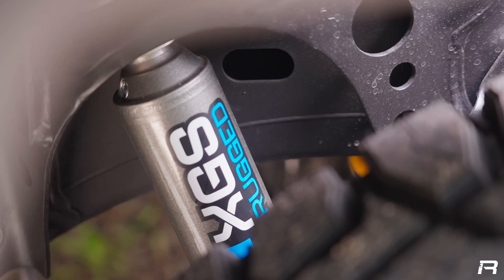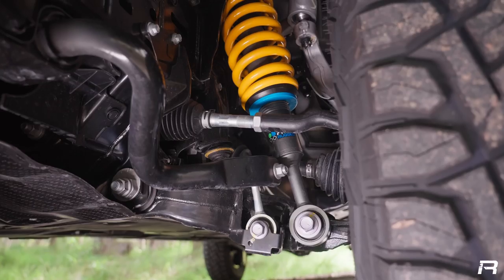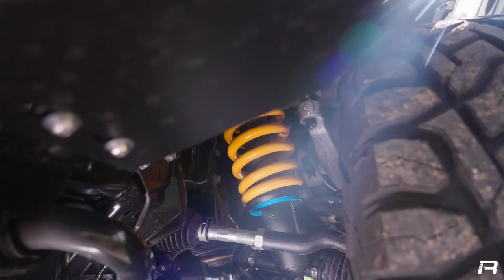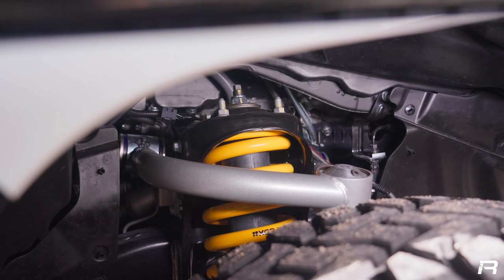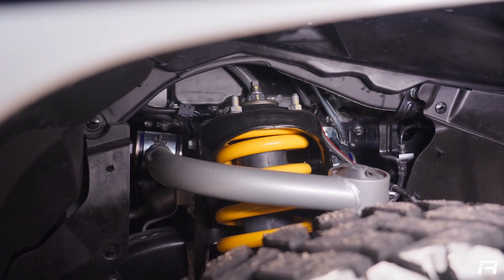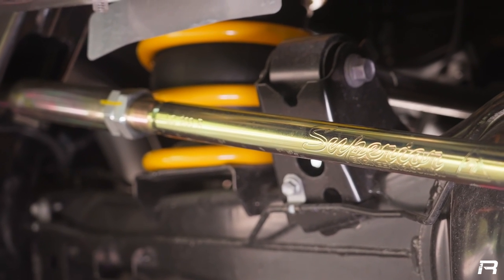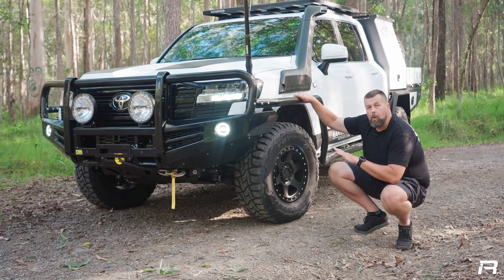On this one, we've got the Rugged Range, which is a new monotube range from TJM. This can be done in the Roma and Remote range as well, so depending on intended use and budget it can be upgraded to different suspension options. On top of the TJM suspension, we've got the Superior Engineering upper arms which allow us to adjust the caster in the front, Superior Engineering diff drop, and their panhard rod in the back to ensure that when the vehicle is aligned it meets all factory specs — so it drives right, feels right, and corners right.